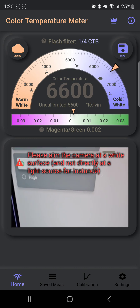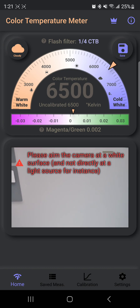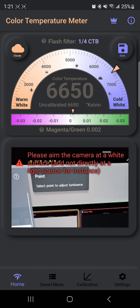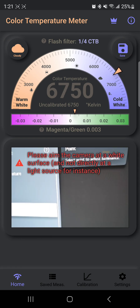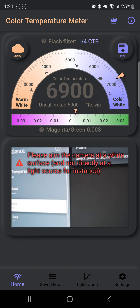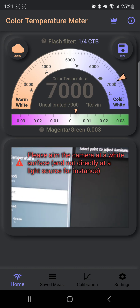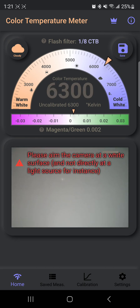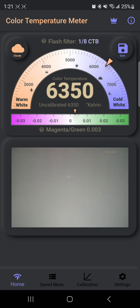Now I'm going to select the low point and change to the lower end of the grayscale pictures. For the higher end it doesn't matter too much because we are hitting ABL anyway — with full-screen pictures, ABL is kicking in so we're not getting a meaningful brightness difference. The grayscale pictures are linked in the description. We're on picture number 22 and this is showing 6400K, which is warmer than 6500K.